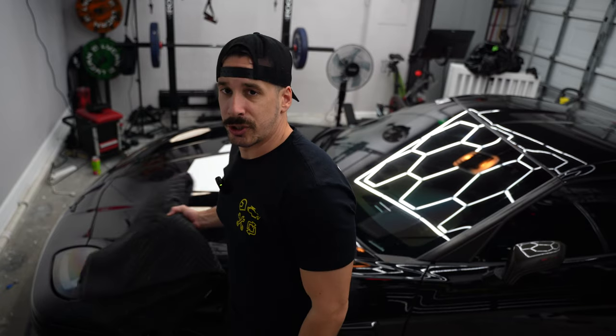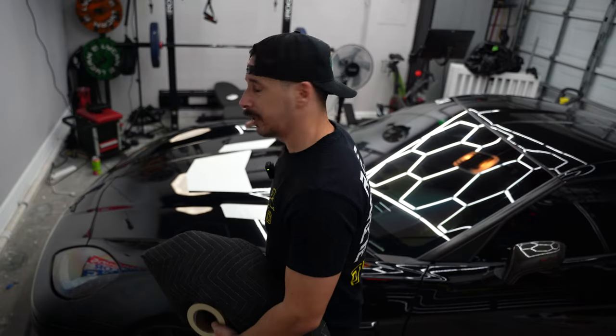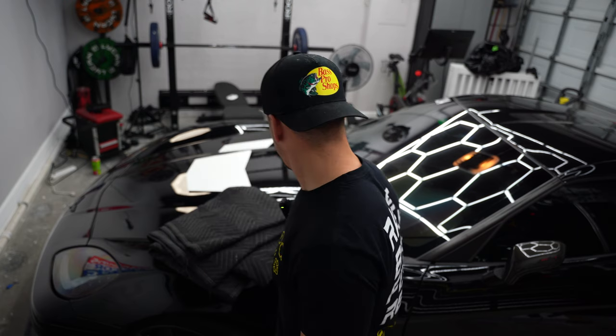There are a couple of things I'm going to use to make sure this job gets done correctly and safely. I'm going to line my engine with this moving blanket — basically lift the hood, cover the engine with the moving blanket, and stretch it out to cover the fenders. I don't want any of the fiberglass dust to fall through onto the motor. It is fiberglass, so you want to protect yourself — I'm wearing pants, I'm going to put on long sleeves, and I'm going to wear gloves. If you have protective eyewear, definitely wear it. And obviously, masking tape to mask the areas. I'm going to measure the center of the hood and mask that up. I know a lot of you Corvette guys buy those with the beautiful Corvette logos — if you are running these hood vents, you will not be able to keep your pretty hood insulation. So choose one or the other. I'm going to rip mine off, put the moving blanket on, and get ready to start marking up and cutting.